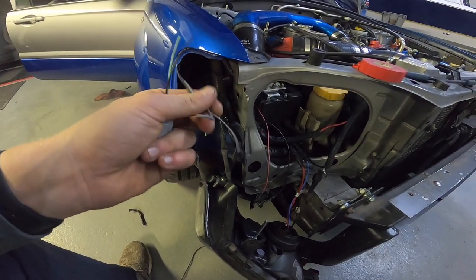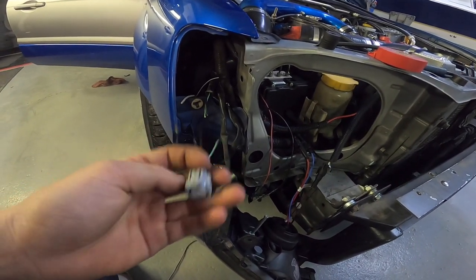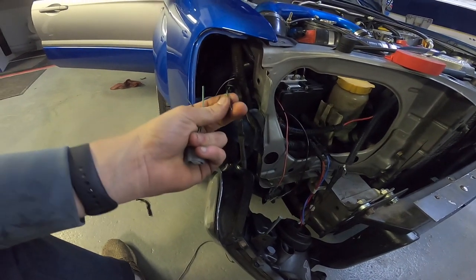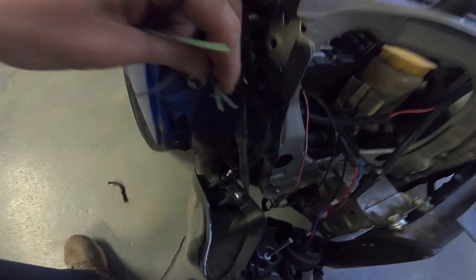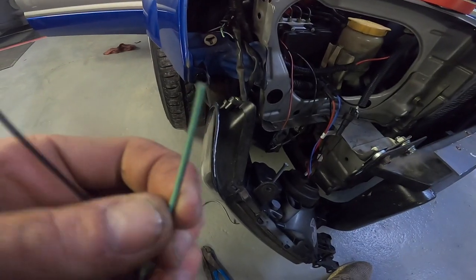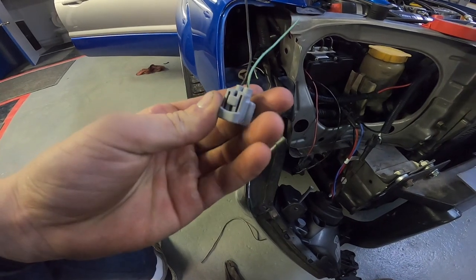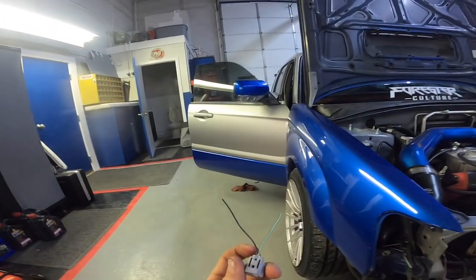All right, we got the wires to the front — that is a success. I went ahead and cut off the turn signal clip. I'm going to go ahead and make sure the power is in the green wire. I know that the gray wire is my power, so basically we're going to try to splice both of these into one connector — the green and the gray — and then connect it to the green on the plug side. Then we'll go black to black to black and get the grounds right. We're going to make sure there's power in that wire and get it all hooked up.